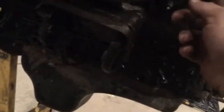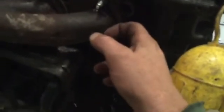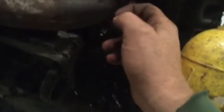And another thing I did, because the biggest problem, the reason why these Fords break the exhaust manifold studs, is because you've got two different styles of metal here, okay? You've got aluminum, a steel gasket, and then cast. What happens is on the back side of the steel gasket, corrosion starts and it starts to push out on the exhaust manifolds, which causes these studs to break.